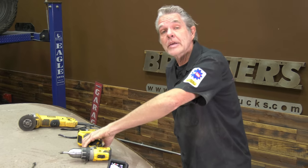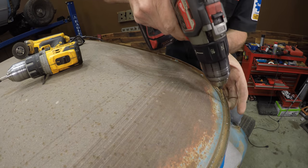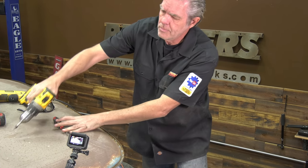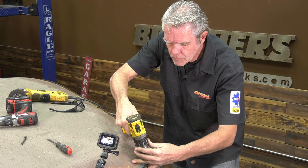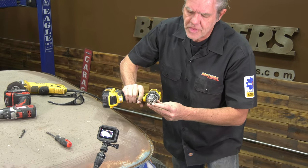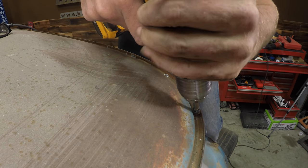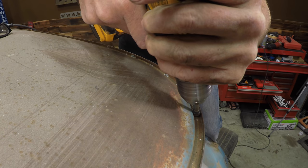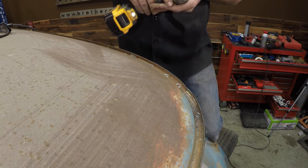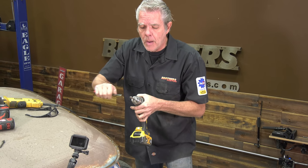Now, I just want to give you a couple more helpful handy hints on taking this out. A lot of times you're not going to be able to see the spot weld on top. You can feel on the drip rail on the bottom and find them a lot of times. And then get a pilot hole, make sure it's deep enough so that when you're drilling this, it doesn't walk around on you. When you're drilling it through, again, we don't want to go through both pieces of metal. You'll notice that the teeth are about the thickness of the metal. So once the teeth get buried in there, then you know you're done. Also, sometimes you'll see a puff of dust come up, or you'll hear a little bit of a pop. So there, you know it went far enough. Sometimes that little disc will get stuck in here and you won't be able to keep drilling out, so you'll have to have a screwdriver on the side and pop any of those discs that get stuck in there.